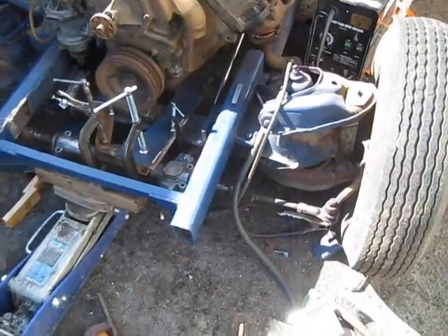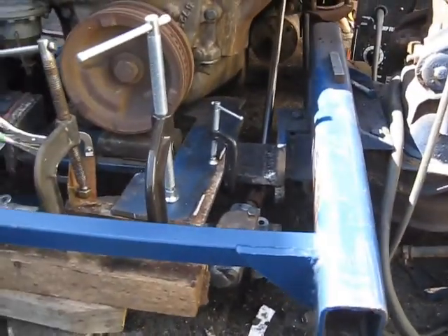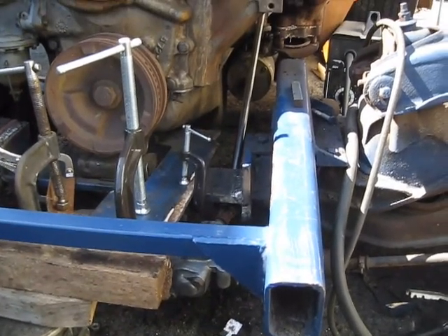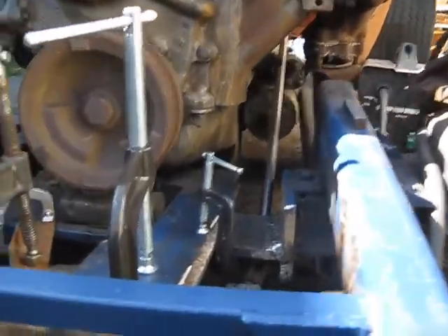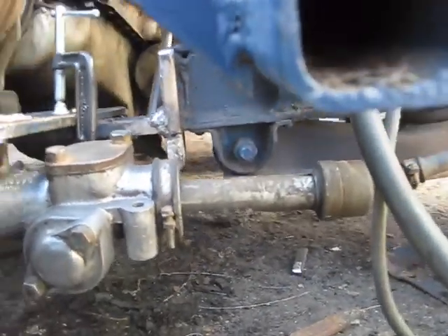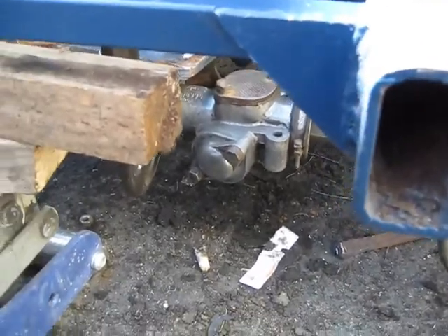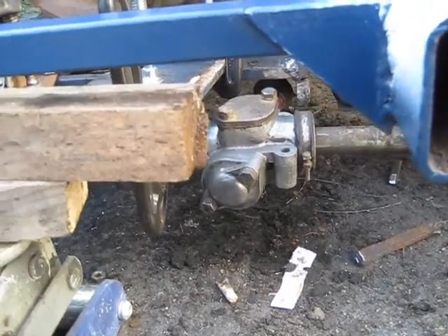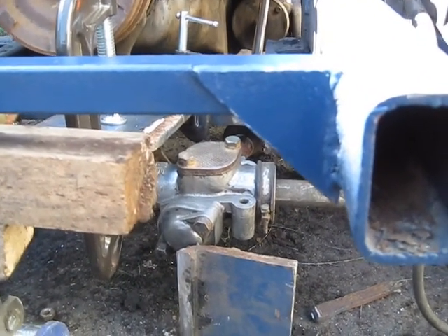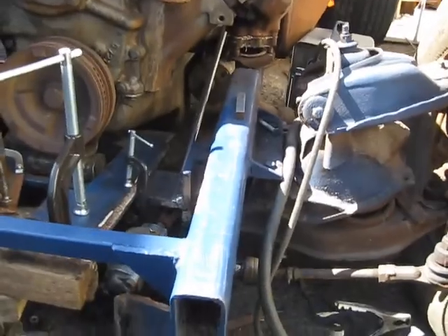Here we have another conglomeration. I got this motor mount all in and welded up. I had really bad toe-in and bump steer here, then I discovered that this has to be kind of level with this bottom swing arm bolt. You can see I got — yeah, not very much — this is 4 inches, so I got a little less than 4 inches to the ground, and this is with the suspension all the way down.